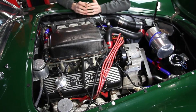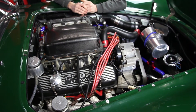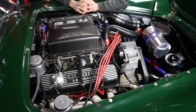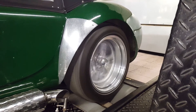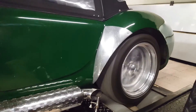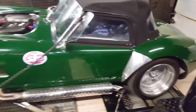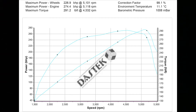So that's the plan — we're going to show you every step of the way, what we do and how we do it, and hopefully you'll enjoy it. Following the dyno session, we noticed a bit of a misfire at the top end. When monitoring the AFRs, we also noticed it's started to lean out a little bit, so obviously we're going to investigate that. We peaked at 275 horsepower and 290 pounds-foot of torque. Eddie had it on a previous dyno run at 285 horsepower, so the misfire is losing us about 10 horsepower at the moment.